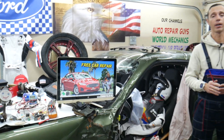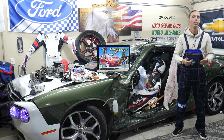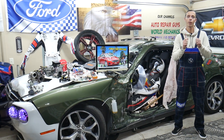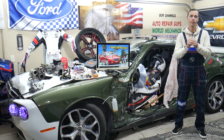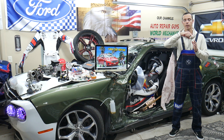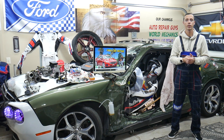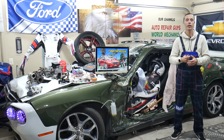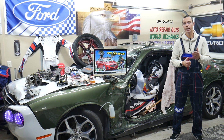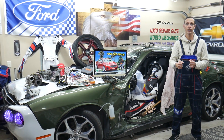Other things that can cause the rear view camera not to work: it could be a bad camera — they're exposed to the elements, water, cold, freezing, all kinds of stuff, so eventually they could fail. We've also seen cases where the connector for the camera is not plugged in. And one time, on a trunk that was opened multiple times — probably used as a delivery vehicle — all the cables that transfer from the trunk to the body had a wire that was pinched there.